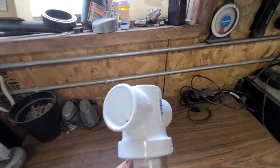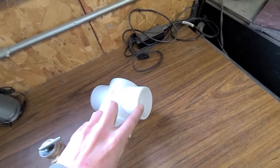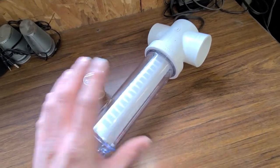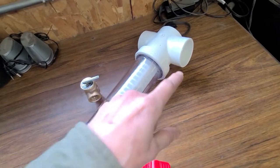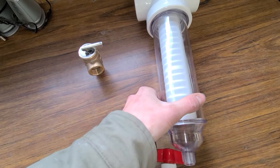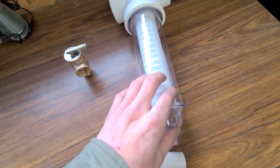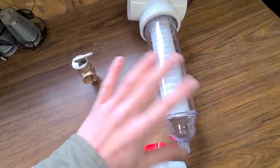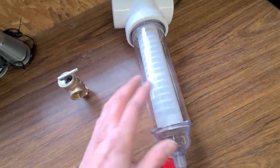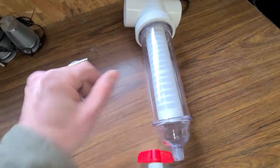This thing's rated at 150 psi or something, so we're not going to have an issue with that. In terms of flow - we're talking about two inch PVC here. I got these slip-fit reducers that I'm going to glue in that immediately step it all the way down to half inch pipe, the size fitting the rest of the cooling system uses - five eighths hoses and half inch pipe. I don't think we're going to have a flow issue, but aside from that I'm up in the air about this thing. There's going to be a lot of crap running through here - algae and weeds and whatever - this thing may plug right up and be a pain in the ass to flush.